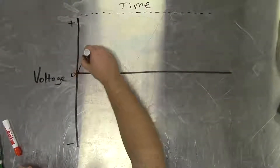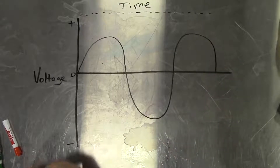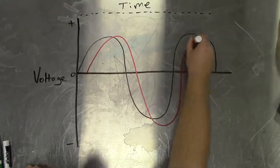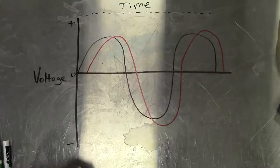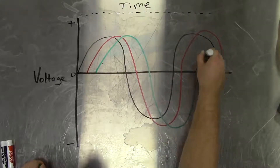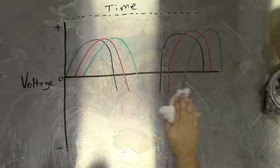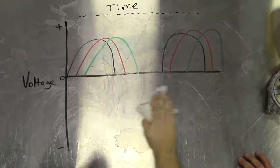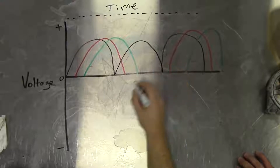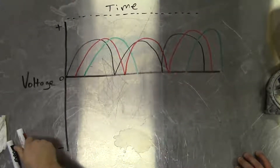Here, I am making a crude graph of the raw output of the alternator. As it is an alternating current, you can see it goes high above zero and low below zero. I am using three different colors because there are three different windings inside the stator, and each color represents the voltage output of one winding. Here is a demonstration of what the rectifier bridge actually does — it has diodes that convert the lower AC voltage into DC voltage that is usable in the vehicle's electronic system.